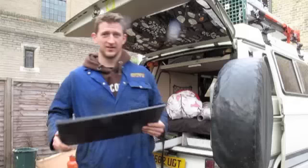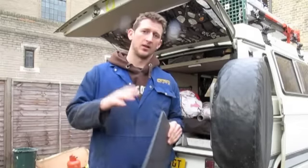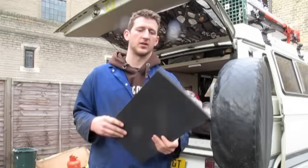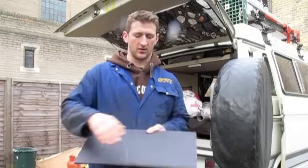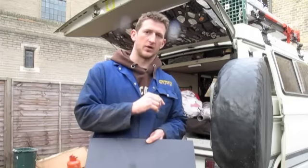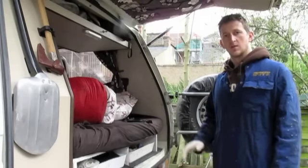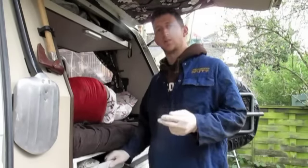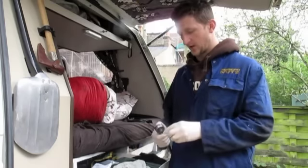Here's Jed to help — how very kind. What are friends for? So I've been onto eBay and did a search for a nylon sheet. They came in all different widths. I managed to get some which was 8mm depth, and I bought a piece big enough. What I'm going to do is make three spacers — put two together on one side to give 16mm and one on the other, and that should level out the lean. For this job we need two 19mm spanners and a 19mm ratchet and socket if you have one.